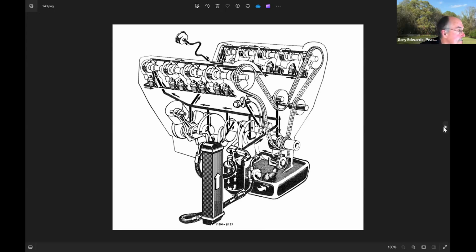Okay. And then Michael Latino asked, when you remove the rockers, did you keep the cams from jumping from spring tension? No, I didn't have a problem with that. They just didn't. And then did you replace the pins like you do the guides? No, the pins are not really wear items. They're hard steel, and you don't have a problem with that.